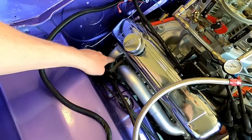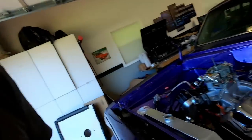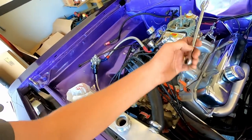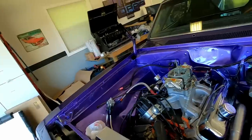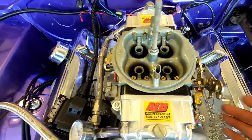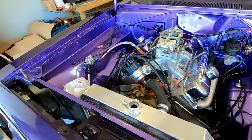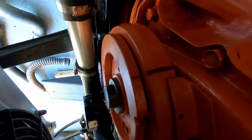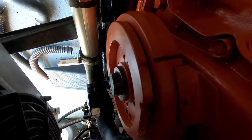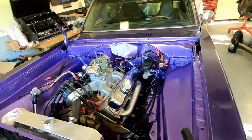Yeah, 45 straight, 90-90. I've got my earmuffs on because this is about to be loud. Got my half inch ready. My idle's probably fine. I have got fuel up to this point. You can see it's wet in there. I'm not going to pump it much more. We should be about 20 degrees. You can see I have that turned about that far back before the zero. Start us off somewhere around there and see if it runs.